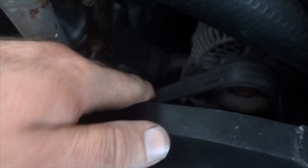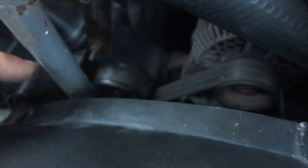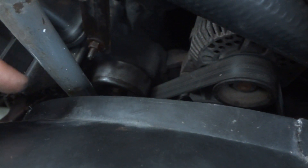The idler pulley was making a lot of noise. What I did was put a long screwdriver first on the alternator and then put my ear on the other end. When you stick something in here, especially when the engine's running, you better be very careful — try that at your own risk. The alternator was fine, but when I put it down on this part, it was making noise right where that pulley is.